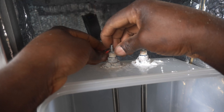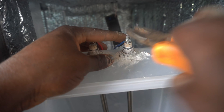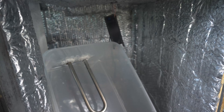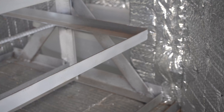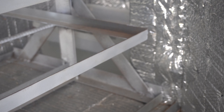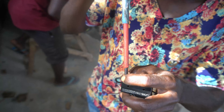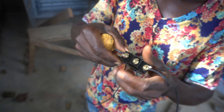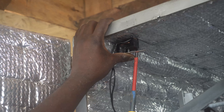Though not mandatory, I installed a fan in the humidity room to allow rapid distribution of vapor in the incubator. Once connected to your incubator with power, always ensure your humidity rod is completely submerged in water before turning on your machine. Now we mount the turner motor, connect the stopper, place the egg turner into the incubator before connecting the motor to the main wires leading to the controller board.